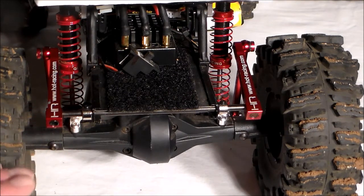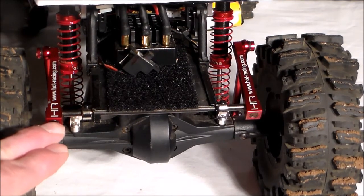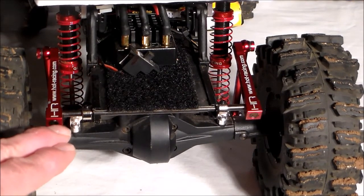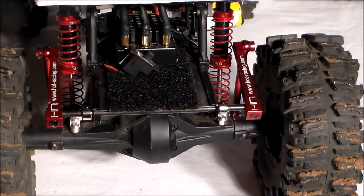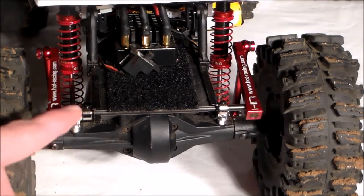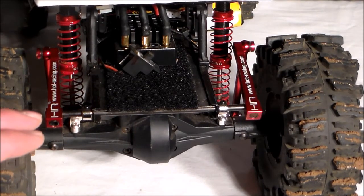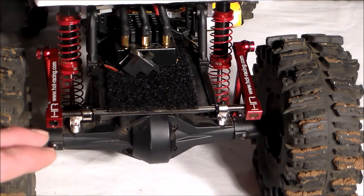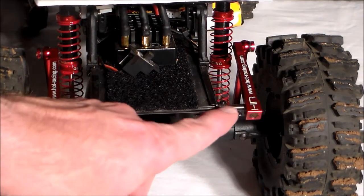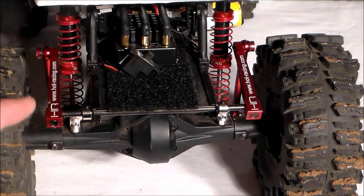So you'll have to cut it to 125 millimeters. The sway bar is ground on one side flat - obviously the set screw has to have something to bite into. That's the hardest part of this whole mod - regrinding that torsion bar so that it matches the other side. Those flat spots have to be lined up. All I did was clamp the bar down, go slow, make sure the bar is not moving on you, and grind away. All you need is a little flat spot to get it to hold on to. These collars are going to have to have a flat spot to bite into also.